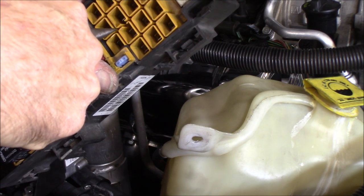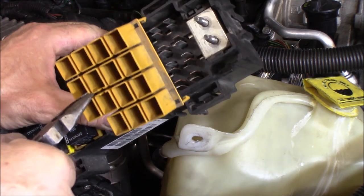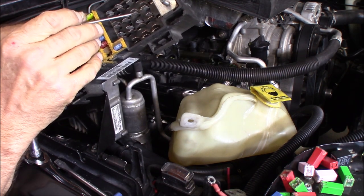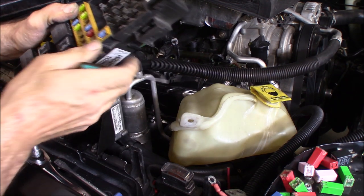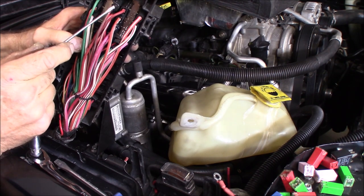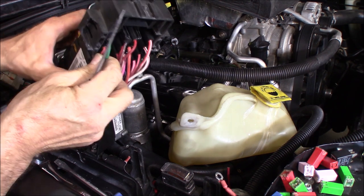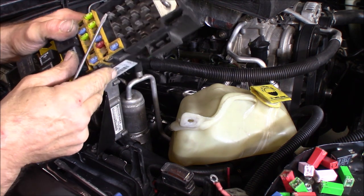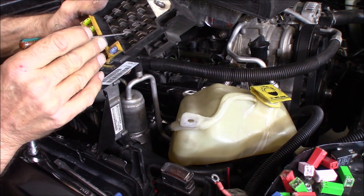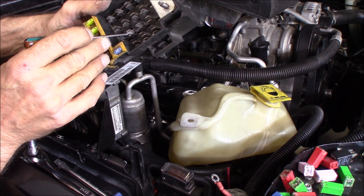You'll need to release the two locking tabs on the back side before removing this piece. Got that out of there. Now down inside here, in these terminals, there's a locking tab on each one. These also can be brittle. What happened on mine as I installed them — it actually snapped. And you can see right here I used JB Weld to actually seal it into place. I won't be needing to remove them. This particular box is very brittle — it's seeing way too much heat. You're going right down in here, slightly pulling over, and you can release the terminal to pull it out.